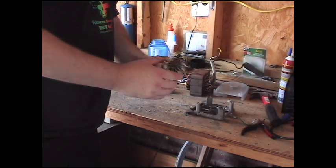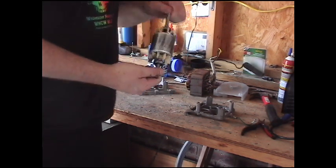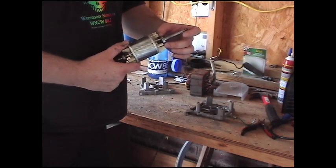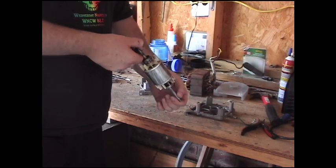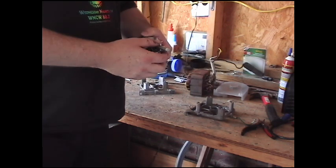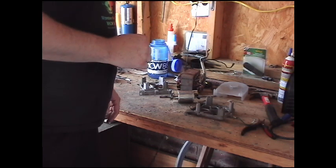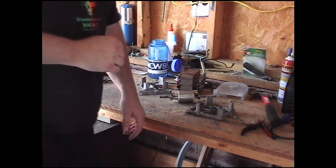You can order them on Amazon — they're $4.98 a piece, prime, from one supplier. I've got a press on the way, a little gear puller, to go ahead and pull these things off. We'll use a little piece of black iron pipe to knock them back on there once we get them replaced. So anyway, that's the problem — that's the culprit, that little front bearing right there, chewing itself all to pieces. The motor comes right apart, and good luck taking yours down. Let me know if you have any questions, guys. Thanks.